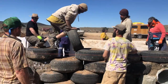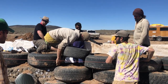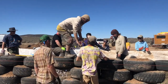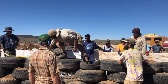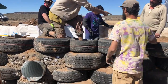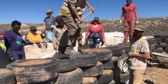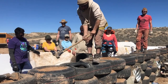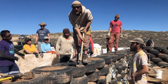I start with the tire pretty much totally vertical — the finishing move is like that. Then you take a level; you've got your strings so you go up level. Then you take a sledge and go up, whacking from the inside of the rim. Leave about an extra half inch, because the tire will expand when you pound.